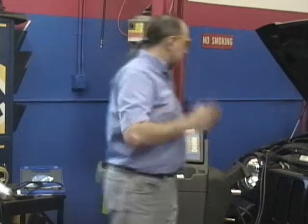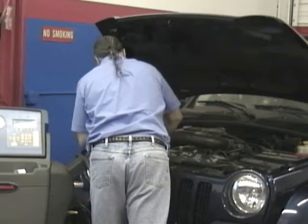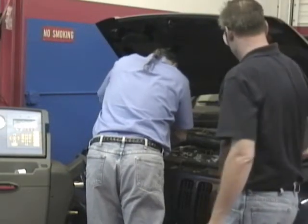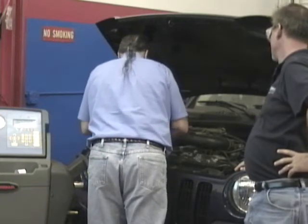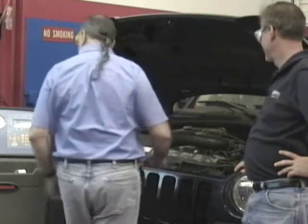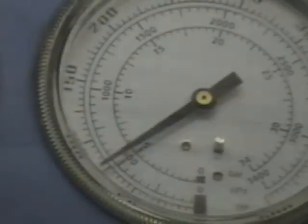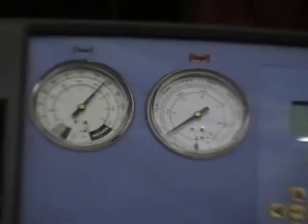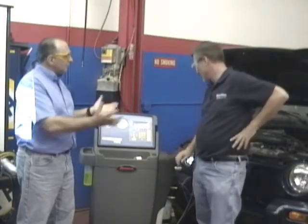The next step - I'm going to put this on here. I put the coupler on, turning it down - low side, high side. Now, one of the things I always like doing: it's about 80 degrees in here, and about one degree Fahrenheit equals one pound. So notice we have about 79 PSI here and the same there - equal pressure high and low side. Peter, what does that tell us? It tells me you've got equal pressure high and low side, so we don't have a problem with something that's blocked up.